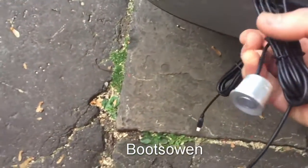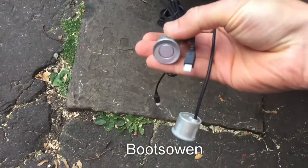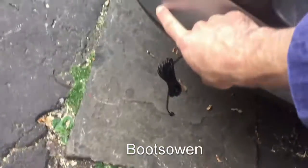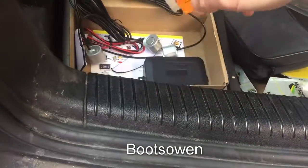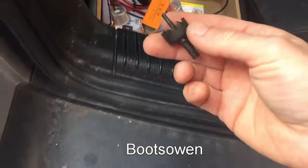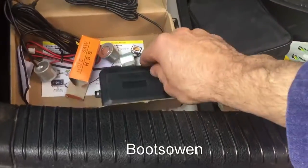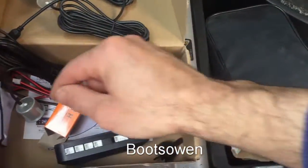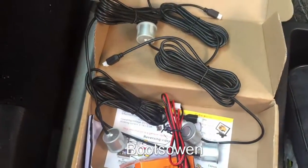I'll put a link below to Amazon to where these sensors come from, but basically all I do is drill a hole in the bumper with the little hole saw that comes in the kit, or I might have another one. Yeah, that'll do it. It's a pretty rough edge actually. I might have a better one than that. But you drill a little hole, push the sensor in, wire it through to this unit, and this unit piggybacks off the lights that run the reversing bulb.